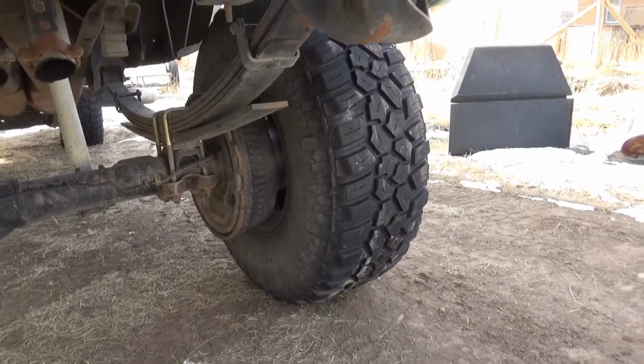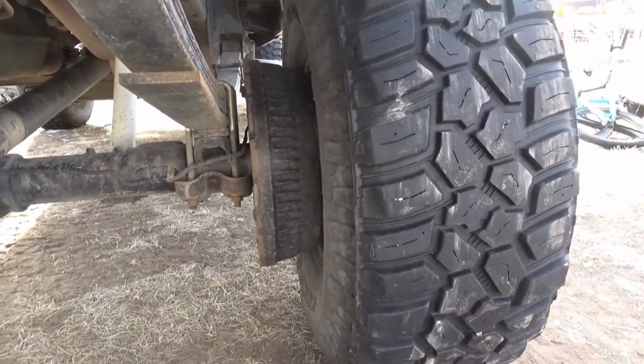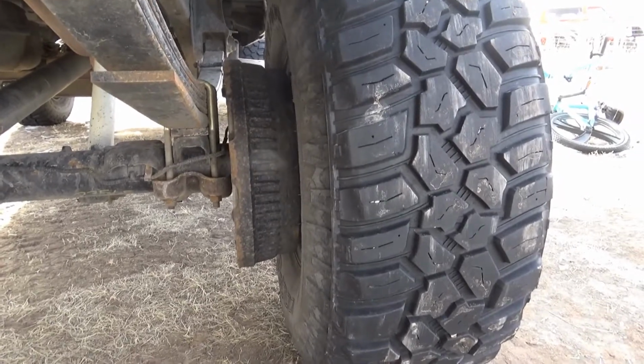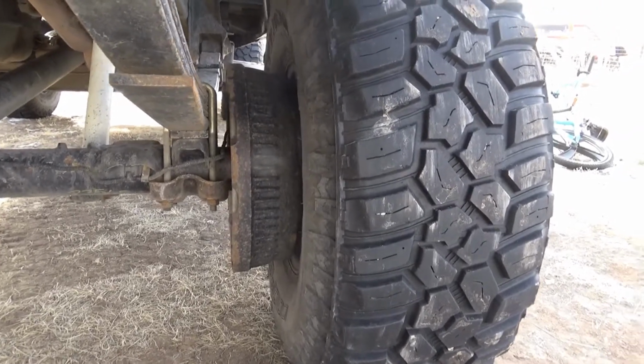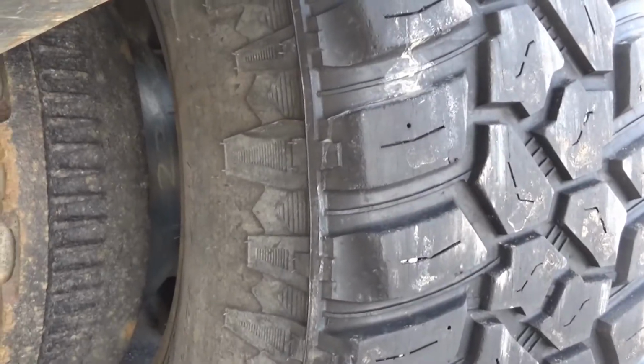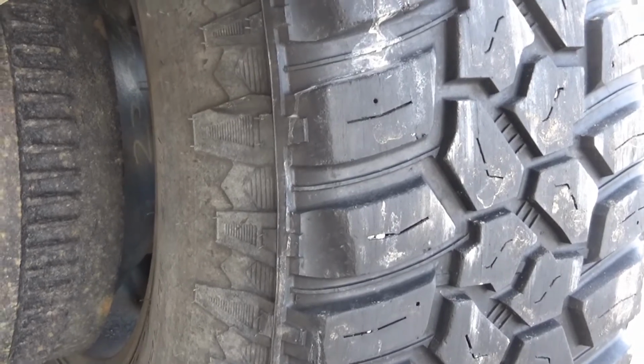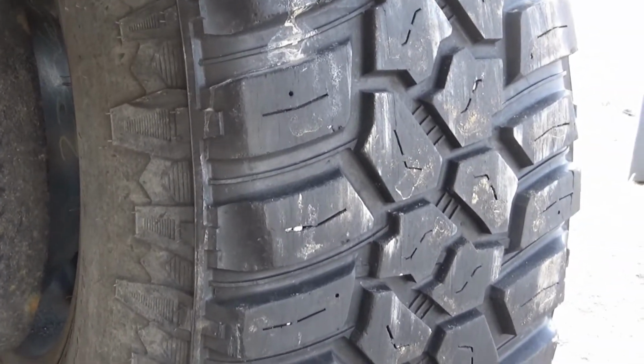All right, so this is a 410 gear differential I bought at a salvage yard. It's actually a two-wheel drive. And the problem I ran into is it's 8-lug. I couldn't do the 6-lug conversion on it. And they're a little narrower than the four-wheel drive ones. So let's see if I can zoom in there. But if you can see the piece of aluminum right there, that's an 8-lug to 6-lug conversion kit I bought to run my 6-lug tires.